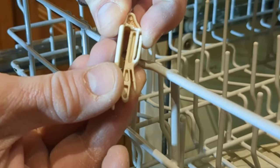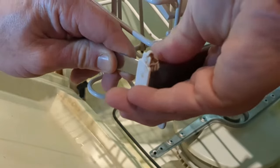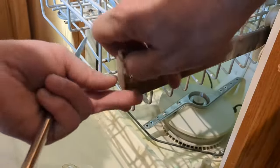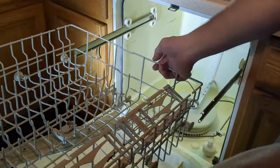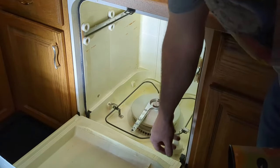This clip just sits off to the side — this is what that clip looks like. I push the stopper up on the other side as well, then pull the top rack right out of there. With the stoppers off, I can slide the rack all the way out — the wheels come out of the track. From this point we've got access to the bottom of the dishwasher.